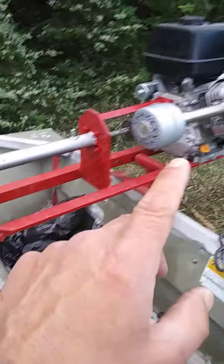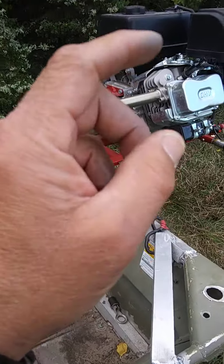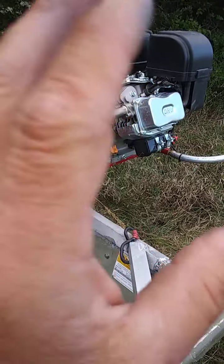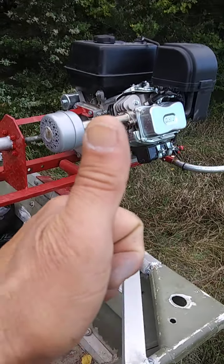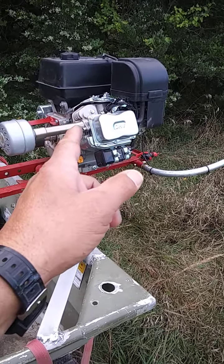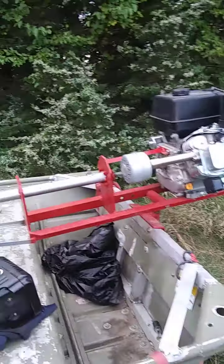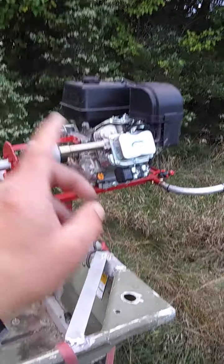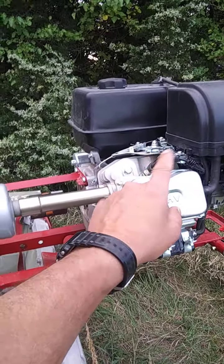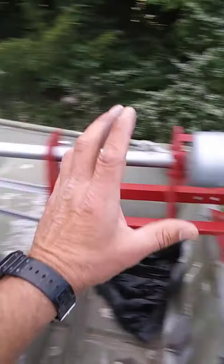I just want to see what it sounds like, and I'm so curious. It's halfway warmed up — I let it run for five minutes. It's supposed to be governed at 3,800 RPM, and I was re-watching the video running at 4,400 RPM till it hits the governor — no valve spring floating, no nothing. I don't want to run it that hard. There's an adjustable stop on the throttle, so I'll probably set it so it can't go over 4,000, running 3,800 under a load.